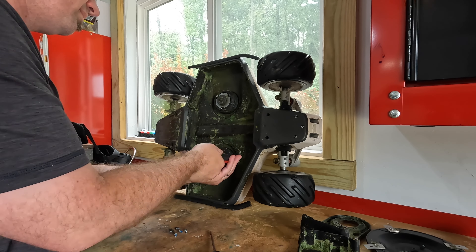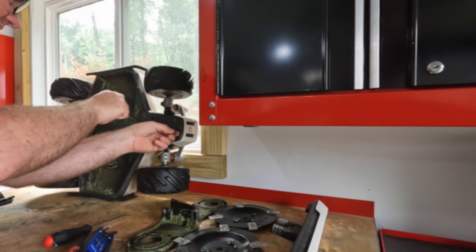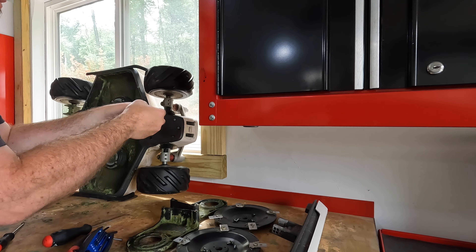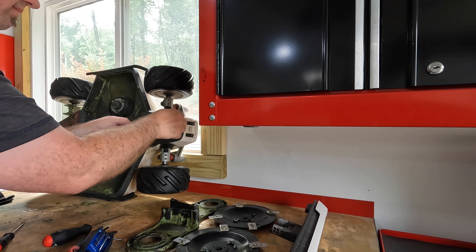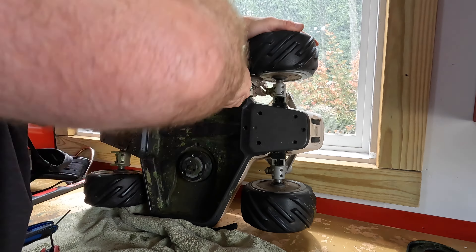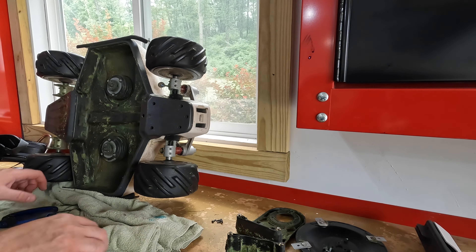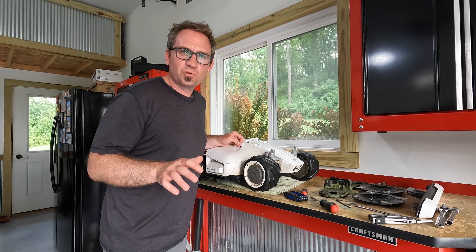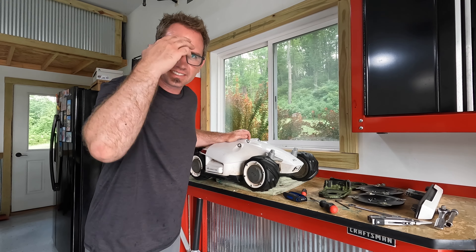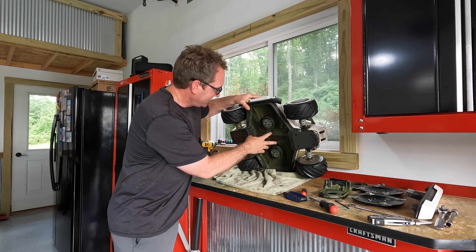You might have to use a couple of different tools to get them all out. Most of the fasteners go into plastic and have coarse threads. There are a few in the front that thread right into an aluminum piece for the front axle, so those are machine screws with typical threads in a threaded hole in the aluminum. Next, you have to disconnect the front suspension — those are socket head cap screws that are really hard to get at. None of my allen keys could fit in there, so I resorted to a vice grip. There were also two obvious screws I somehow missed — filled with grass, but right there.